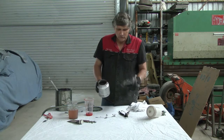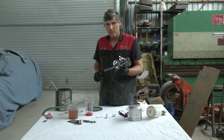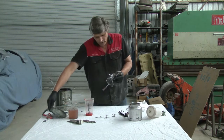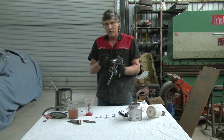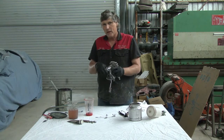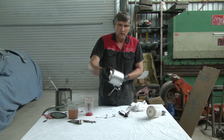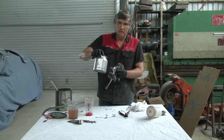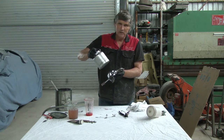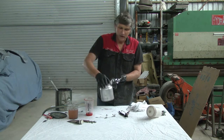Now what we'll do is strip the spray gun. Do not be afraid to take your spray gun apart — it's a very simple piece of equipment. Back in the day, very few painters used to dismantle these guns when they were using acrylic all the time. All they'd do is just rinse the pot out and flush a bit of thinner through it, then go on to the next colour. Over the course of a year or so, the pot would grow with all the drips and runs that came down the outside, quite thick with paint built up on them. Then once a year, you'd strip them down, soak them in thinners and get it all off and they'd be ready to go again.